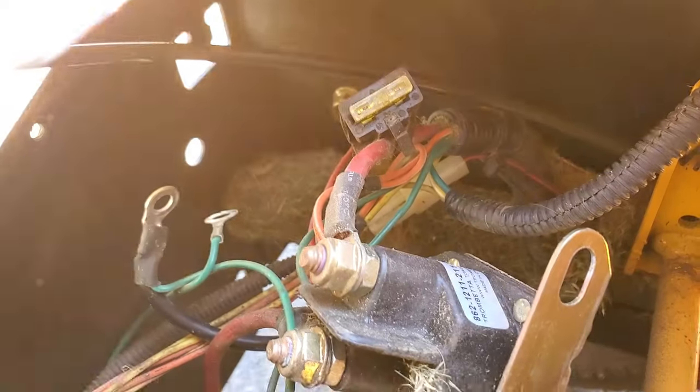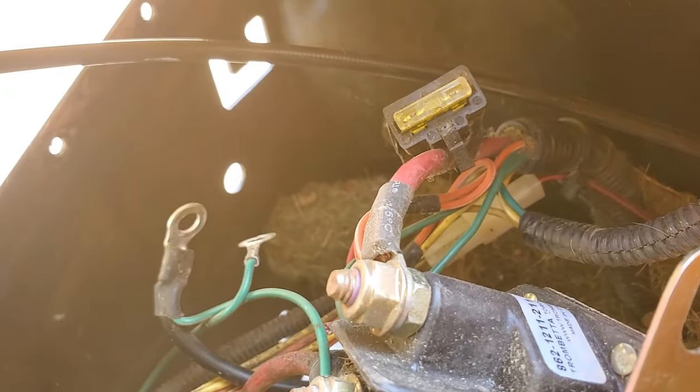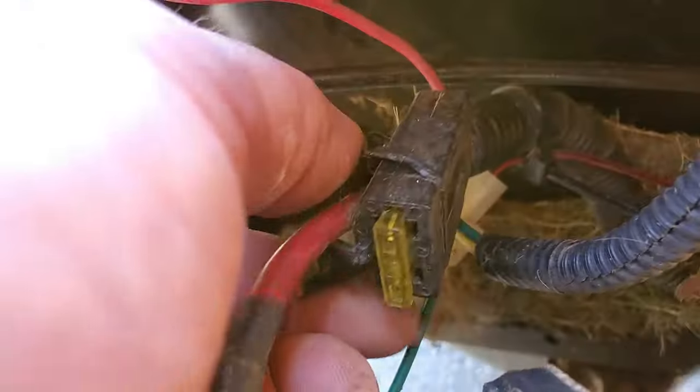So down in here, this here's the fuse. I took that out before I took anything apart. The fuse was still good. This wasn't getting any power up to the key. No battery indicator or no hour meter, anything. Now this fuse was facing the other way. It was on the bottom, and I looked and looked and I saw this wire here. You can see a little green color in there. That wire needs to get hooked up